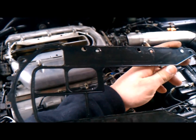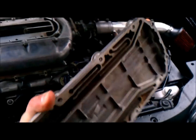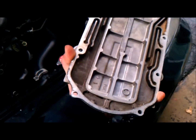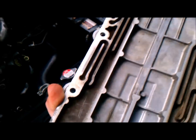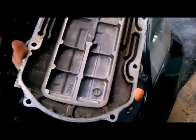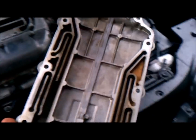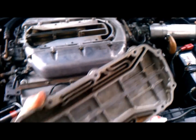It's definitely going to be significantly better now that it's put on in the right direction. The top of the intake manifold — I completely cleaned it out with brake cleaner and a brush and scraped off all the gunk and oil, so all these channels are going to be much cleaner. If you've replaced the spark plugs and ignition coils and still have the misfire, take a look at this — this is guaranteed your problem. Thanks for watching.